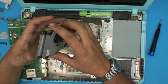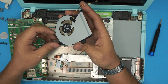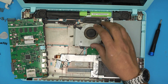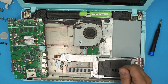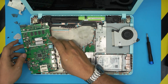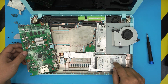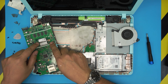We're going to take it outside and use compressed air — I'll leave a link in the description for the air compressor I use, it's really handy to have around the house. I'm going to use my old toothbrush to clean up the fans and then blow air through. I've cleaned up the fan, the chassis is nicely dusted out. Also, I replaced the hard drive — the solid state was for another video I made, so I put the mechanical drive back here.